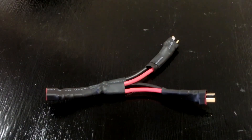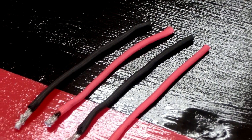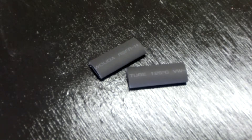To do this conversion, we're going to need to create a parallel cable to hook up both LiPo batteries to the scooter. Get yourself 6 ten-gauge cables — 3 red, 3 black. We're going to use 3 male Deans connector plugs and 1 female Deans connector. Make sure you have some good solder — we're going to be soldering a lot in this project. And a whole bunch of heat shrink wire sleeve tubes, which I call Shrinky Dinks. You'll need a whole bunch and of varying sizes.